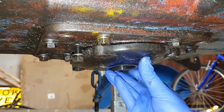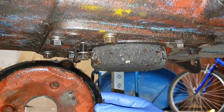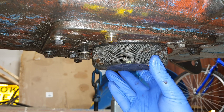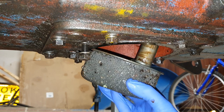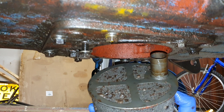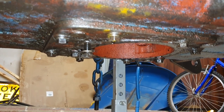Removing the cover plate — pull that down. There's a lot of crud there. We have a wire filter which filters out the bigger stuff: congealed oil and all the lovely things like that. If we pop that out, there we have it — the wire filter. This is going to need a really good clean which I'll be doing a little bit later on.